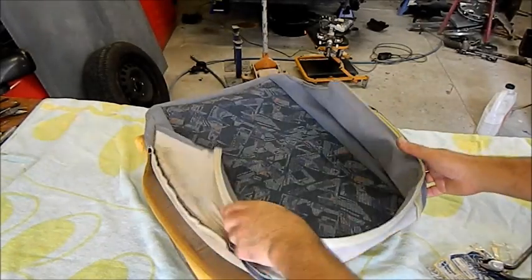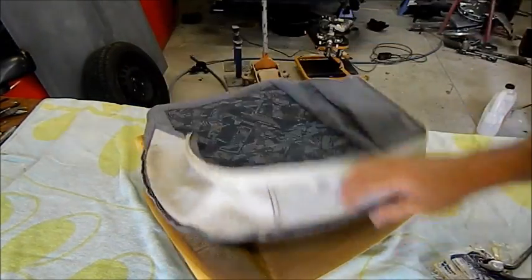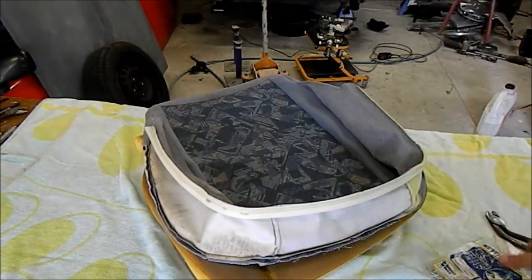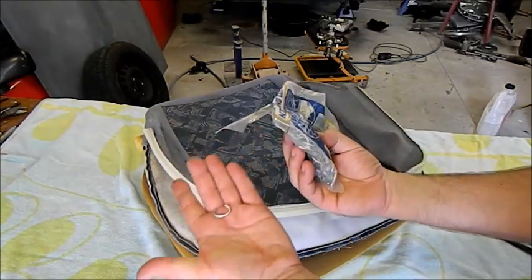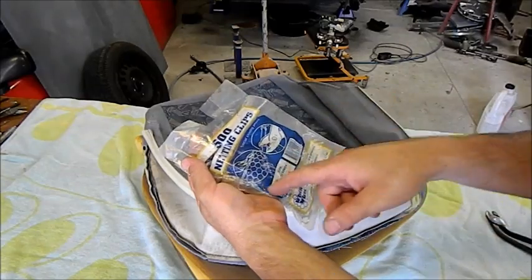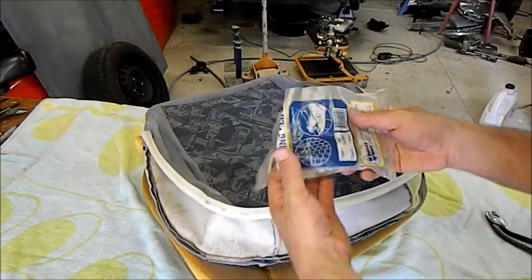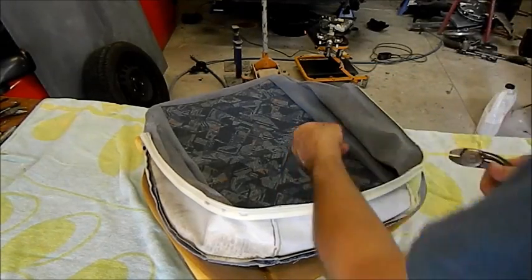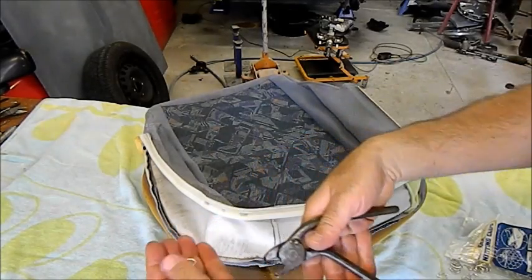Right, we've got to fix these on. I've got the seat cover inside out again. It looks pretty manky, that foam, but again, this is just a demonstration. We've got to use trimmer's pliers, or C-clip pliers if you prefer. And they use a C-clip like the ones we took off. These aren't them, but they do the same thing. These are just netting clips from Bunnings. I think they're about, for fences and stuff like that, about $8 for about 4 million. So we just throw a few out and they'll fit inside the trimmer's pliers like this, and just encircle exactly as a C-clip would.